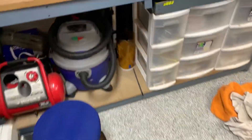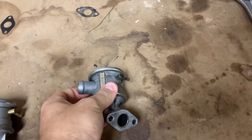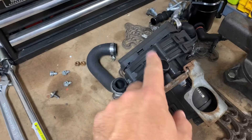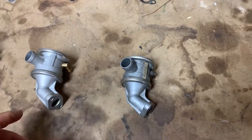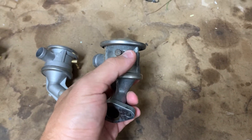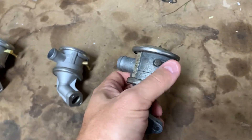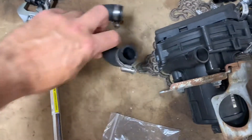It's connected to a secondary air pump that sits right there. The actual issue I was having is the secondary air pump was not coming on, and I'm chasing that down separately, but in the process I found out that this check valve is also not working. Your vacuum line is connected through here going back to the intake manifold, and your secondary air pump is connected with this hose.